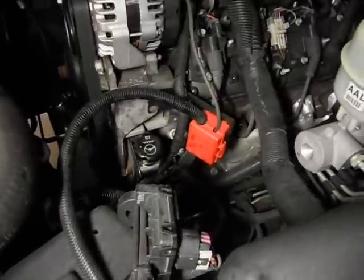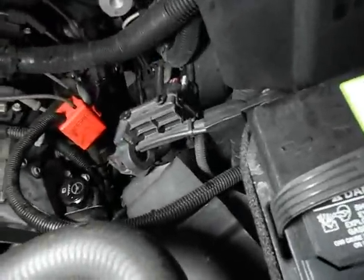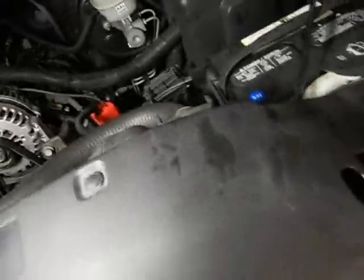It's slightly quieter with the cap on. I forgot to mention the service interval — this should probably be done like every 20,000 to 30,000 miles. That's what I would do. It keeps your power steering system nice. I haven't done this one in forever. I still want to jack it up so I can bleed the system with the engine off just by turning the wheels back and forth. I have a video on that already, maybe I'll do it again.